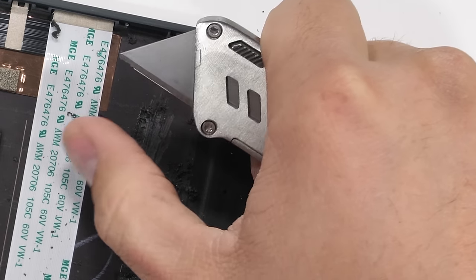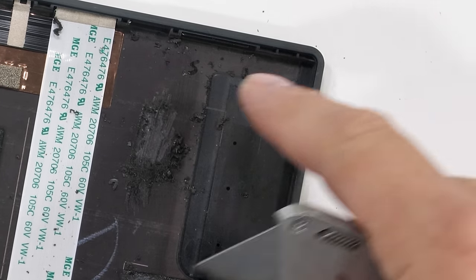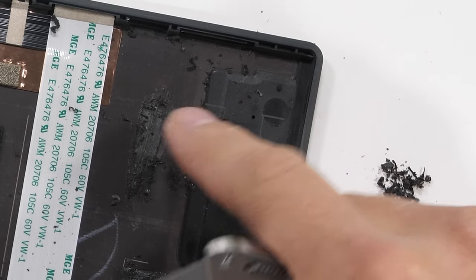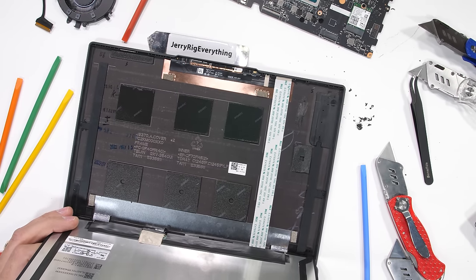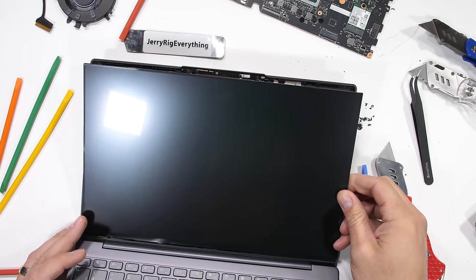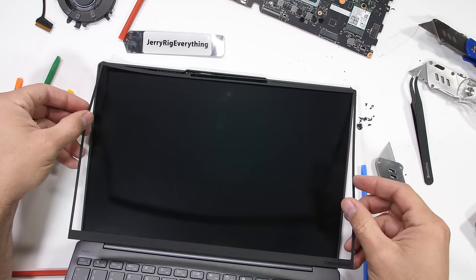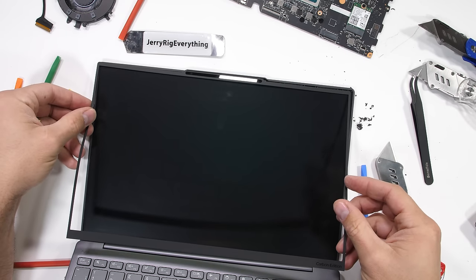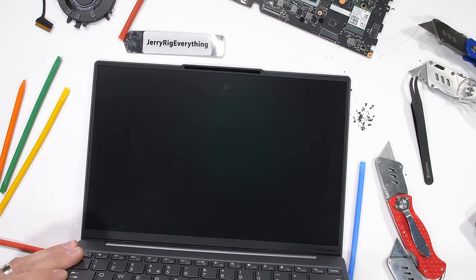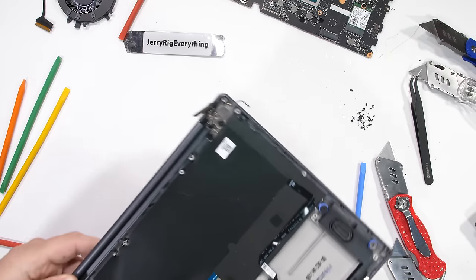Carbon fiber is lighter than metal, while providing similar strength and rigidity. However, I imagine we're only seeing carbon fiber on one half of the laptop because of the thermal conductivity. The screen side of the laptop needs the rigidness, but the bottom side needs to be able to dissipate heat generated by the components. And carbon fiber tends to be more of a thermal insulator, which is a good reason to not use it on the bottom portion of the laptop where all the heat is generated. It's a pretty cool setup, and fun seeing different technologies and processes come into play to create something unique.